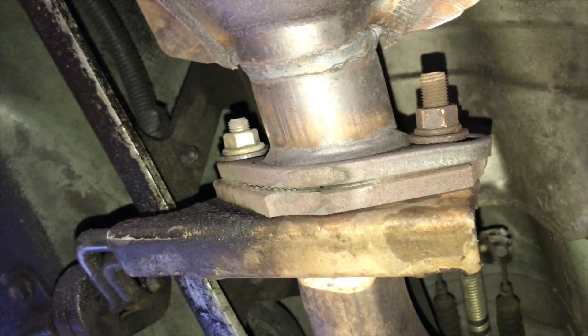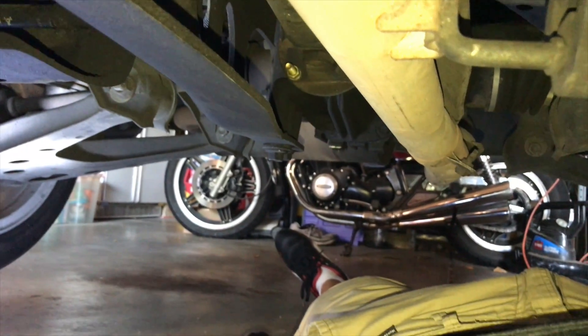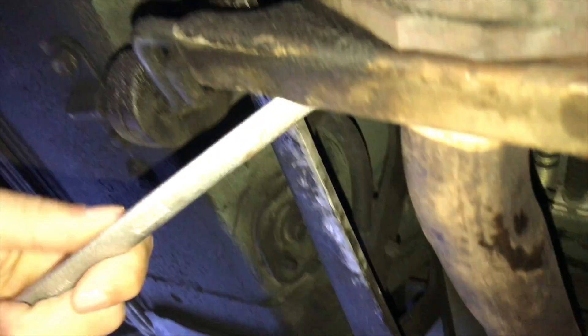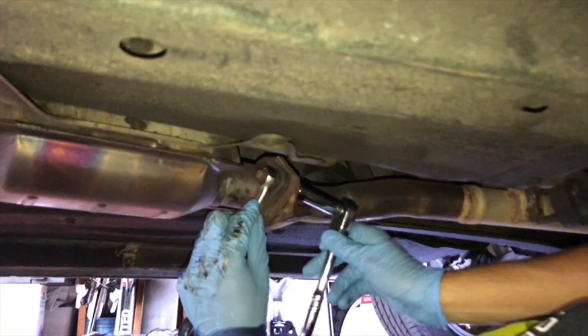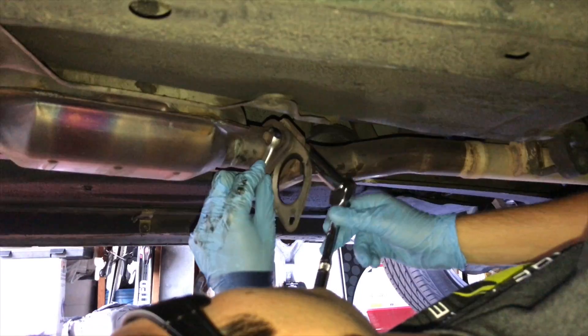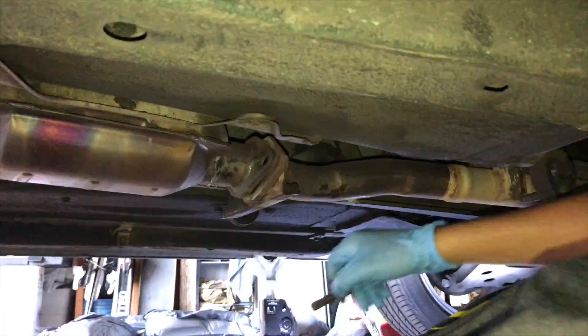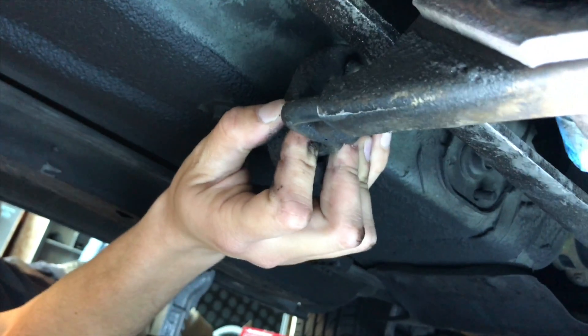So keep that in mind if you're gonna do this at a friend's house. First, what we had to do was get the car on jack stands in all four corners, get under it, and then we removed the stock exhaust gasket — that's from the cat all the way going back. We removed the gasket first. Thankfully my gasket wasn't all messed up; it just came out really easily. At that point, we undid the bolts from the cat going back, and then we had to deal with the hangers.